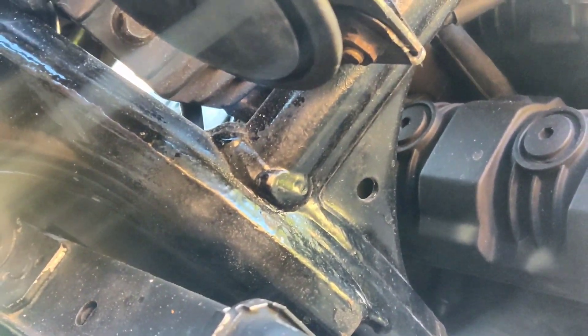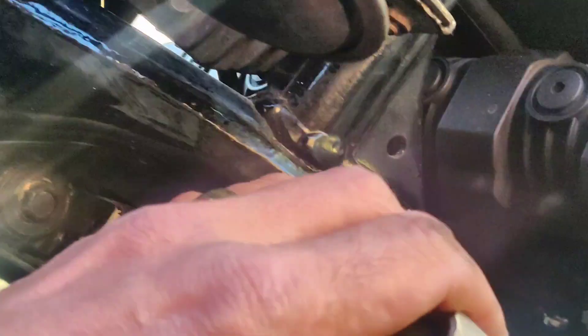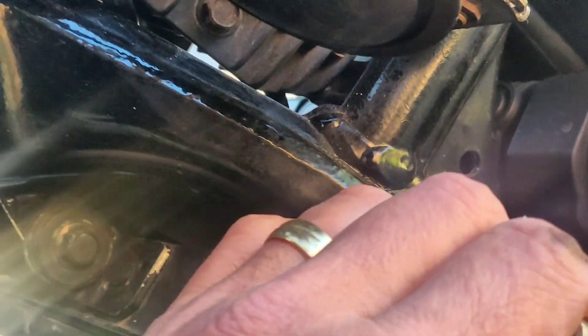I'm not entirely sure I'm going to be able to get you in to see, but that is the offending bugger. You can see at the top where it meets the actual head — it's starting to pull out where I'm putting more torque on it to try and seal it off. Which is a bit annoying, but so be it — these things happen. So it's going to have to be water out, pull it back. I've ordered the helicoil for it. I can actually see the plate isn't at the right angle — it's not sealing. So yeah, have another attempt at that.